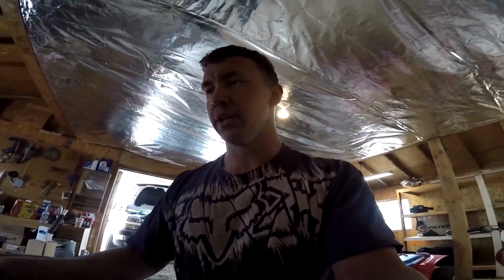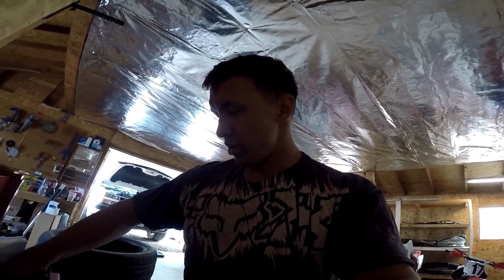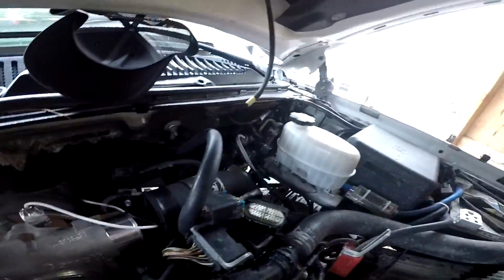On LBZs, you have to take out the driver's side uppipe completely to reach the fuel return line bolts. So I'm going to unbolt the bottom and top side of that uppipe now, which is cool because I'm pretty sure I can leave the passenger side in and just get the drain pipe bolts out, and then this turbo's out. It's probably been about an hour, because I've taken a break and went to Dunkin' and all that. But it's really not that bad, guys. It's pretty easy. Like I said, flex head ratchet and that short 10, you can get everything.